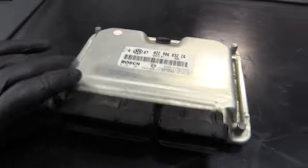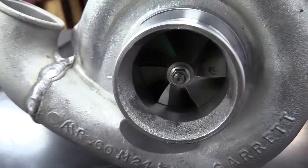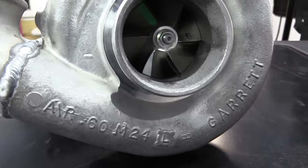The third thing we're going to need when adding a turbocharger is proper engine management — the ECM. We need a computer that can compensate for the increase in air and fuel demand. Simply putting new injectors in without tuning will probably make the car run worse. On an older car it's literally a chip that gets installed; on more modern cars it's an ECM tune, sometimes via OBD port to change the fuel and timing mapping. In some situations you're also electrically controlling boost pressure.